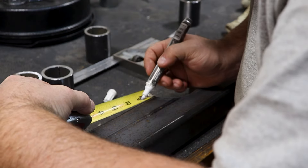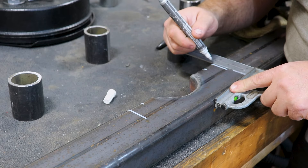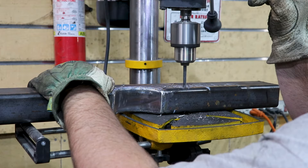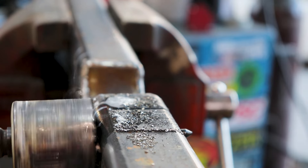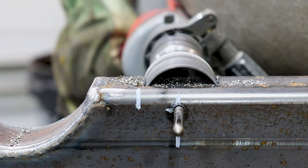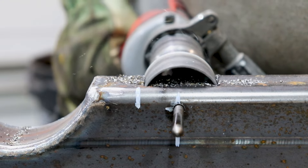For connecting the control arm to the axle I will have two points of contact. The two points of contact will prevent the axle from twisting when applying the brakes. I'm also going to be using polyurethane bushings at those points of contact to allow a little bit of flex and movement between the right and left side.